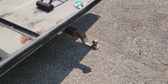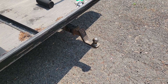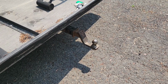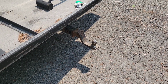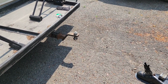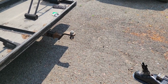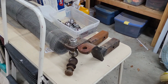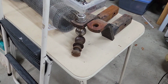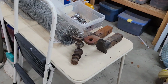Using the stinger that I usually use for this trailer, the one that was on the green truck, is going to put that way too low. But what if I flip that ball over and flip the stinger over? That'll raise it up. I think that's what I want to do. So it'll look like that. Honestly, I wouldn't mind raising up a little more, but I don't think I have another stinger that I can easily swap. As it turns out, I do have a stinger that's just a little bit taller, flipped upside down, and I've got extra balls, so if I take that 2-inch ball and put it on there, I won't even have to mess with the other stinger.